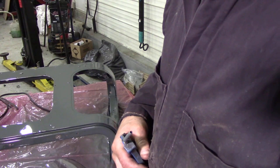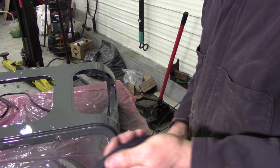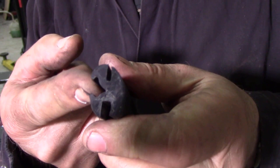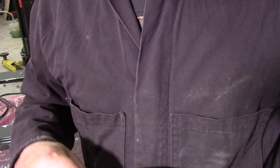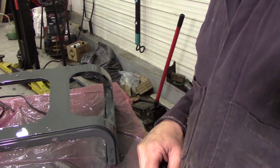I'm going to fit the windows using the old rubbers. They're starting to crack a little bit at the bottom but the rubber's still flexible — if it was all cut and nasty that would be a different thing. I've blown out the gaps here, here and here with the air gun to make sure there's no dirt and debris in there. Where it is cracked a little bit, if it becomes a problem I simply put a little bit of black urethane over it and seal it up.